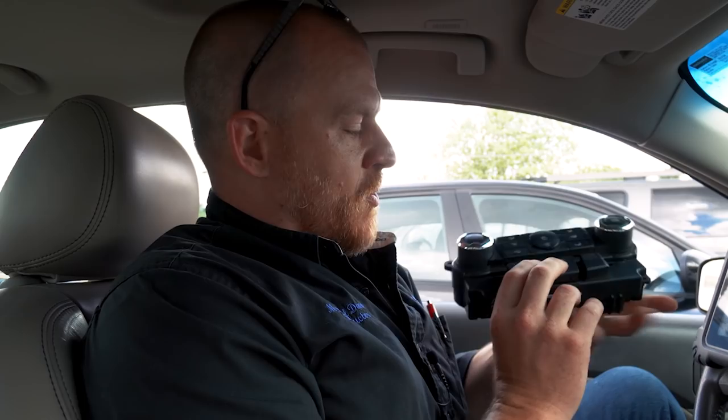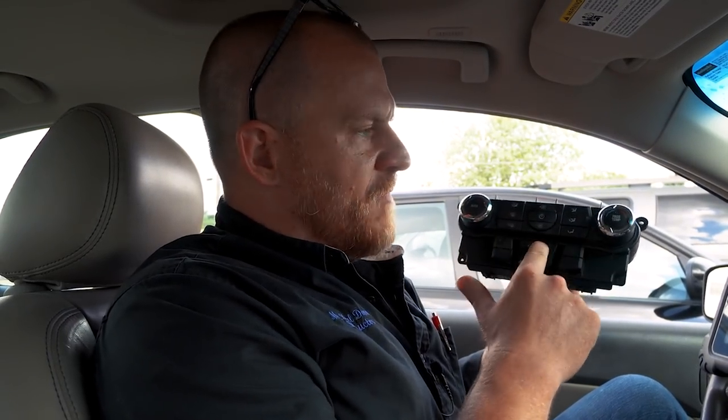And so then you ask yourself, well, how does that signal come in? On older cars, that signal would be a direct tie-in. You'd have a wire that would go from the climate control panel right to the engine computer, and it would be a physical switch input. Right, pull up, pull down circuitry, chapter 2 material in my book, in my premium channel. This is standard stuff. It still is. This climate control panel, we still are using pull up and pull down switches for all of these. So on an older car, you would need to know how to troubleshoot that circuit.